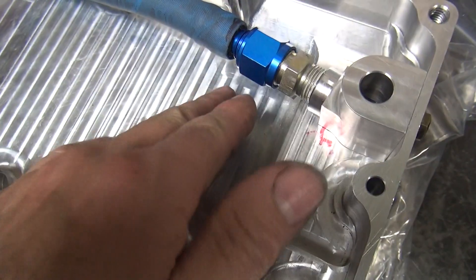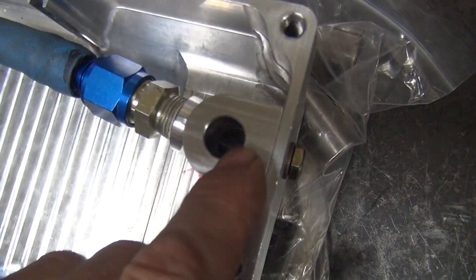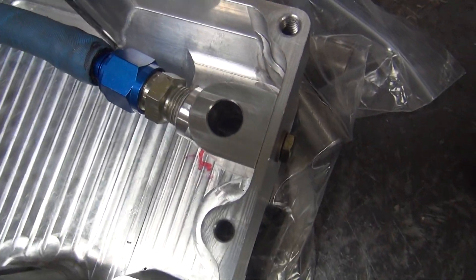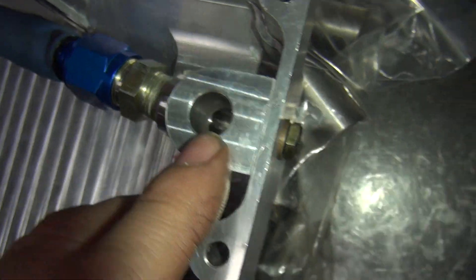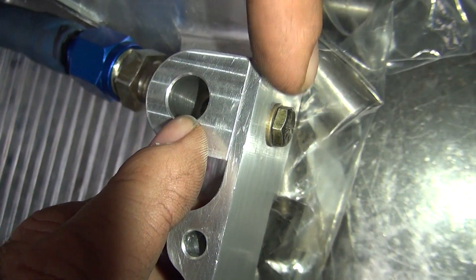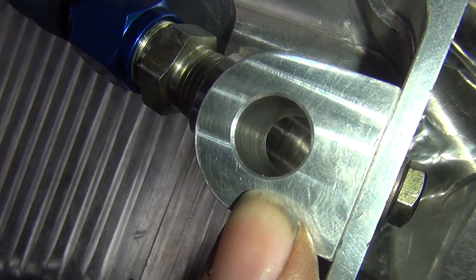You cannot make it go down also because it has a double angle. Now I only have one hole to feed through instead of three corners to go through — right down there. So that means I'm going to go in there with my little porting tool and knock that burr off that you can see right in there.